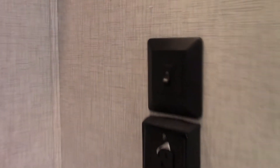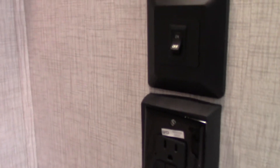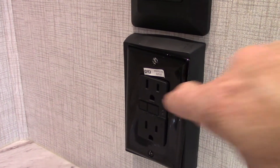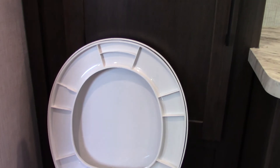Let's head to the bathroom. This is a GFCI — this trailer probably has two of them since it's a bigger trailer. Keep in mind all the plugs are wired through a GFCI. If you're using the plug outside and it pops, you're always going to reset it inside the trailer. The sink and shower work like any other sink and shower. You always want to run your fan when you use the shower to pull the humidity out — these trailers are built super tight these days, so you want to exhaust any humidity created by the shower.